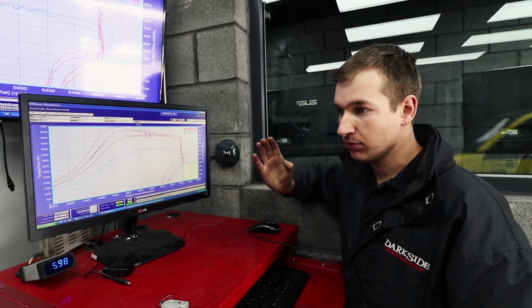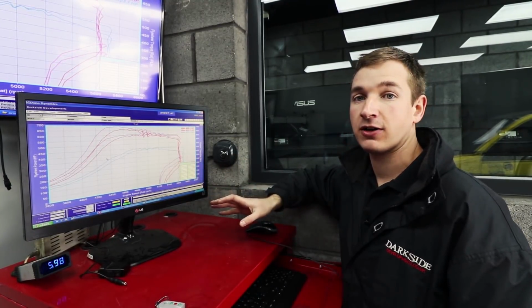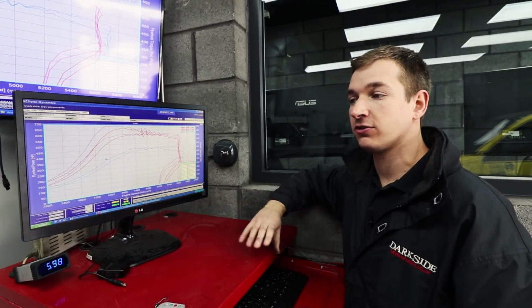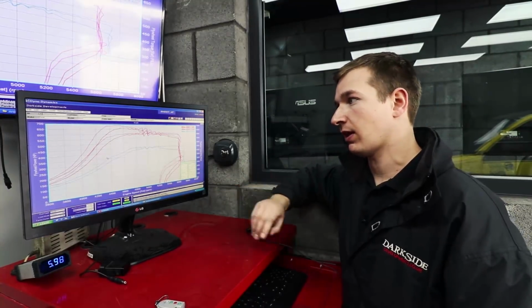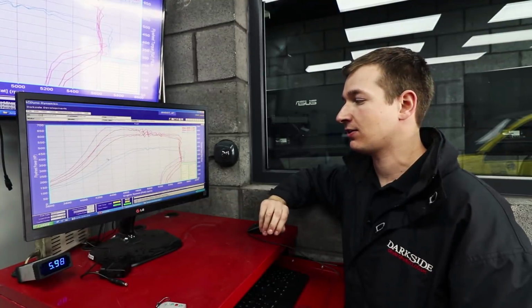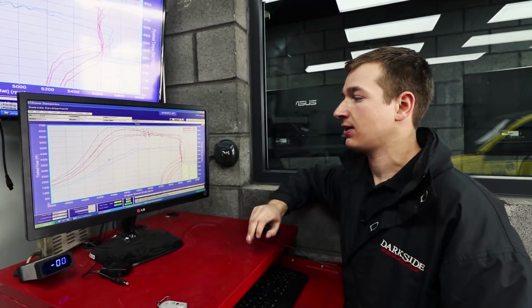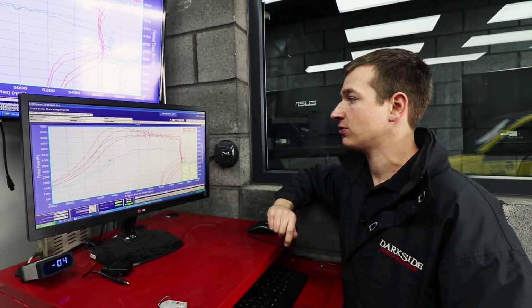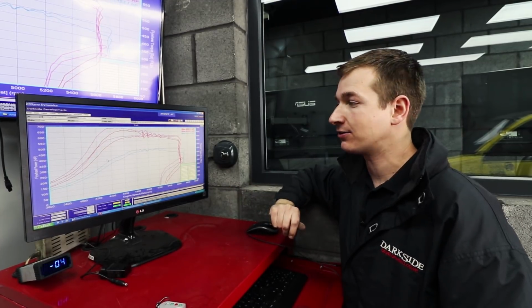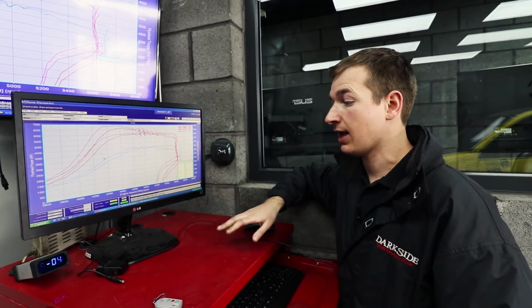But bigger injectors, shorter duration, and the Revo nitrous kit for a drag application, without a shadow of a doubt. You can get away with the pulsoids, no problem, but as far as smooth and progressive power is concerned, that you can change at the track side as you need it without playing about too much, it's the Revo nitrous system that you need. It's expensive, but so is blowing an engine up every few runs like some of the people that we're competing against sometimes do.